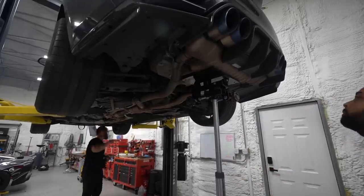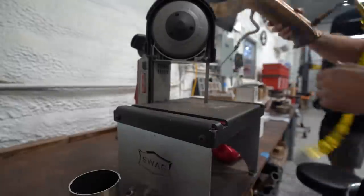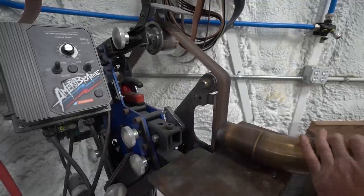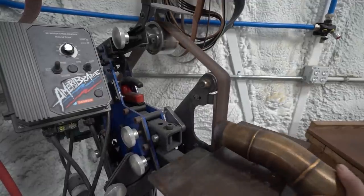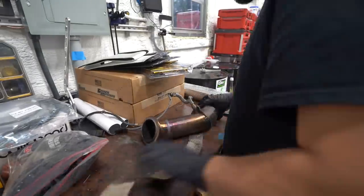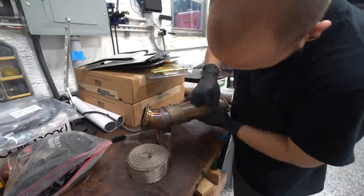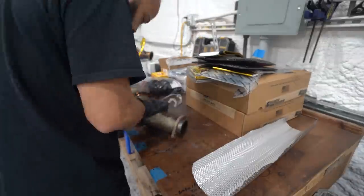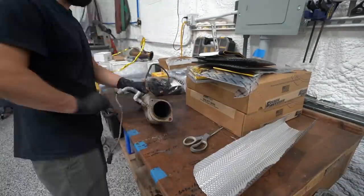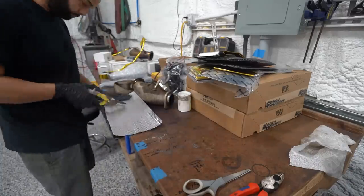We still have some stuff to put back together but we were waiting on parts, so we went ahead and dropped the exhaust out because we wanted to pull the down pipes off. I had the same issue on my other car where one down pipe is just a touch too long and when you put an aftermarket exhaust on it doesn't fit quite well. So I shaved a little bit off, got it cleaned up for the new gasket, and then we decided to go ahead and wrap them. The factory down pipes are very well heat shielded but these aftermarket ones are not — just raw stainless — and it's going to transfer a lot of heat into everything around it. Drifting things get hot, so we wanted to make sure we protected everything around them.